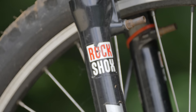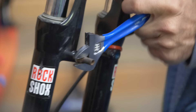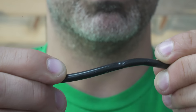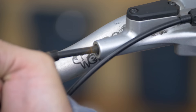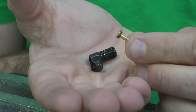One of the things that stuck out to me about this bike is how messy everything up at the fork looks — part of that are these zip ties, but there are also V-brake mounts, which are completely unnecessary. These posts are made to mount an older type of brake, and this bike has disc brakes, so we can just unscrew them and fill the holes with another bolt. But as I'm getting into it, it looks like this front brake hose is in pretty bad shape. To replace it, we need to remove the old hose, measure up a new one, cut it to size, and install new hardware onto the ends.